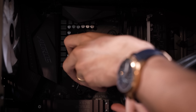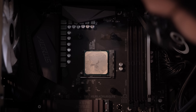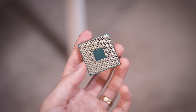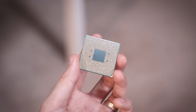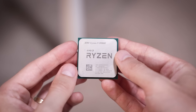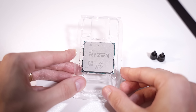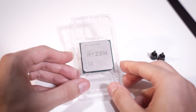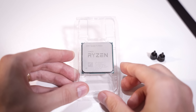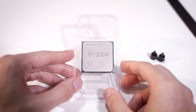Nothing I tried with memory works. Let's see what CPU we have under here — the paste application needs replacing. It is a Ryzen 9 3900X. Both the socket and the pins on the chip look to be intact. I don't see any debris in the pin holes, any bent or missing pins, or thermal paste bleeding. This looks to be at least physically a pretty healthy chip, but because we've already got it removed, I'm going to replace it with a Ryzen CPU I know works from my own stash. In the event his CPU is to blame, the best I have here is a Ryzen 7 3700X — obviously a small downgrade, but still a great CPU for gaming and better than one that's broken.